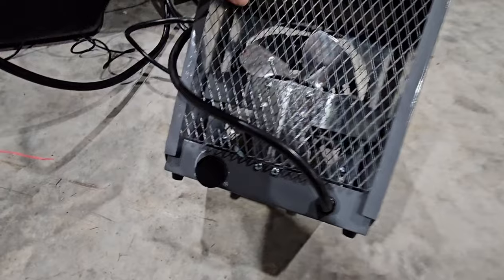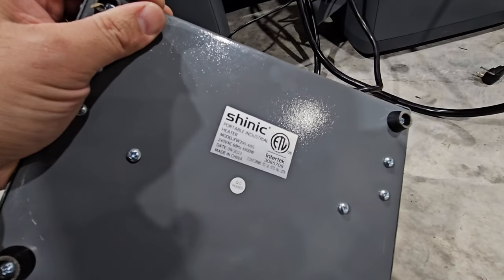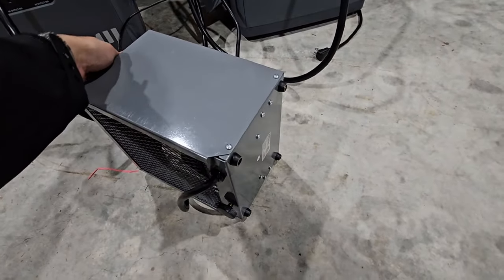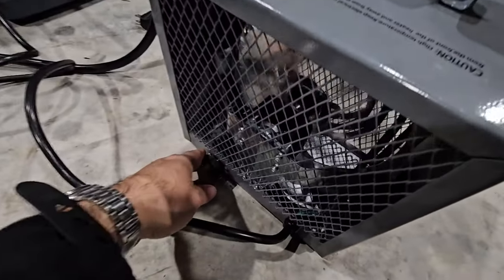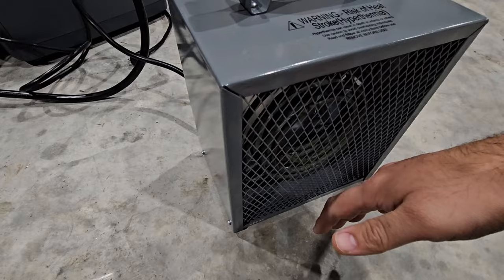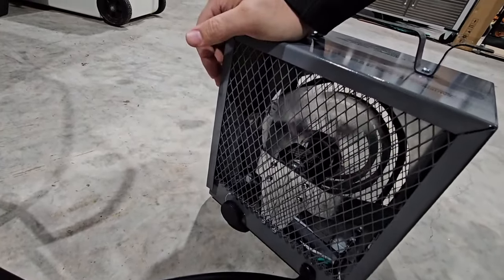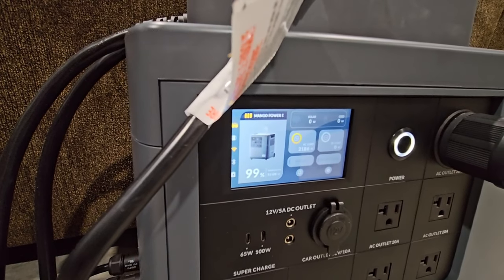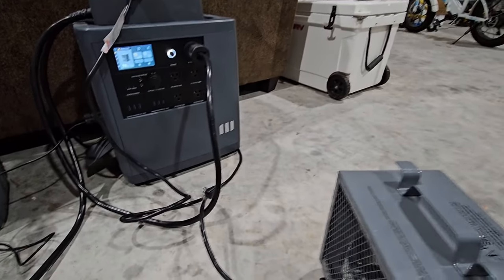Let me show you what's going on back here. Here's your adjustment to turn it on or turn it up. There it is — 240 volts, 4,800 watts. This must be the slightly smaller one; I said 5,500 watts but I'll have to go back and check. Still, 4,800 watts at 240 volt. Let's see if we can get this thing to turn on. Okay, fan is turning on. I have it on low right now. The tip-over protection turned on — let me turn it back on. Now it's on its lowest setting and this unit is pulling 2,186 watts, and 2,165 on the other — so it's splitting it pretty evenly.